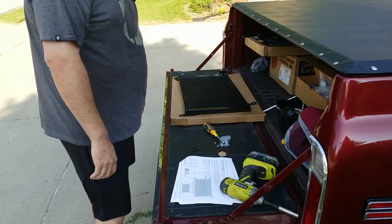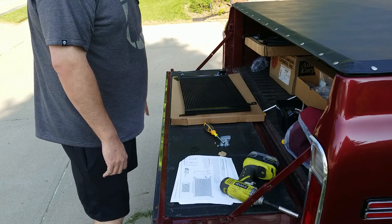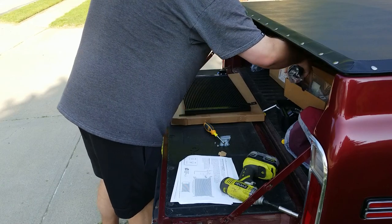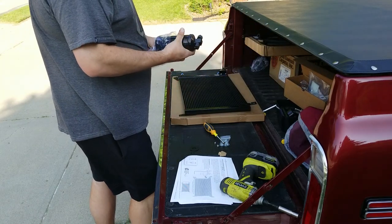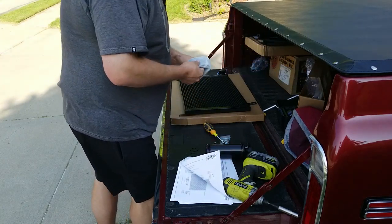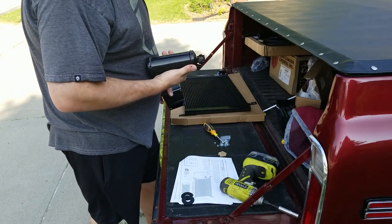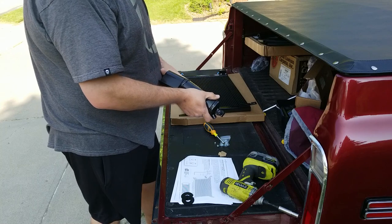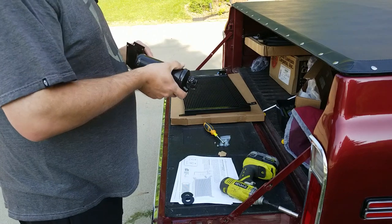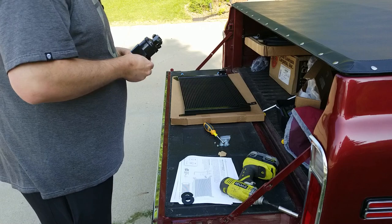Lay the condenser down so the hose connection's on the left side, the larger connection on the top. The dryer is conveniently mounted to the left-hand side of the condenser. Neat. Said dryer. And there's a bracket for it. First, insert the dryer into the dryer mounting bracket. Okay.